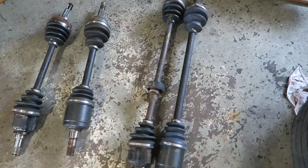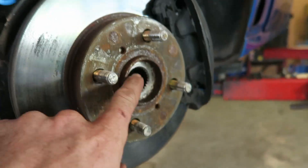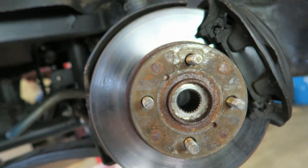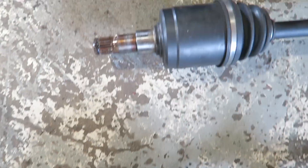These are my Drive Shaft Shop CVs. See the axles on the end where the CVs are — they're a lot thicker, and there are actually more splines in there as well. You get a new hub to suit that larger spline, and the CV joints are much bigger.